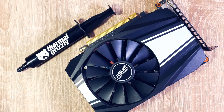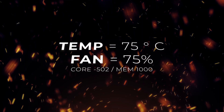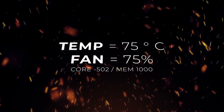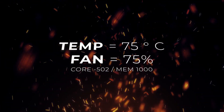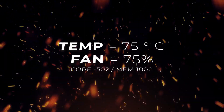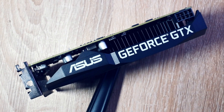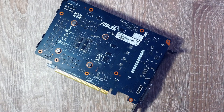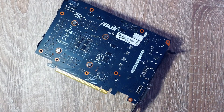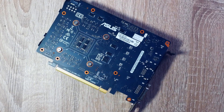To orient where we start out: the card is sitting at 75 degrees Celsius and rising, with the fans already up to 75%. I didn't even start tweaking the card much — just drew down the power limit and gave it a memory of +1000 (which is +500 in Windows). Weirdly, the card does not want to go lower than 88 watts even with a power limit of 70, and lower power limits give back an error. We'll leave the settings as they are so we can compare later.